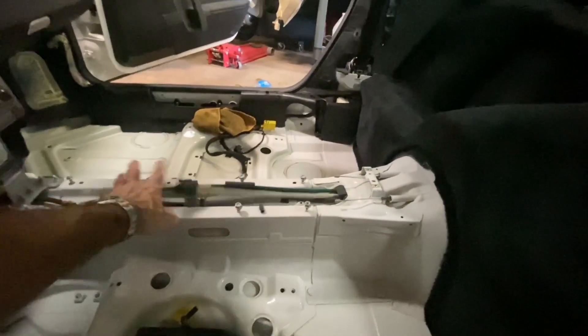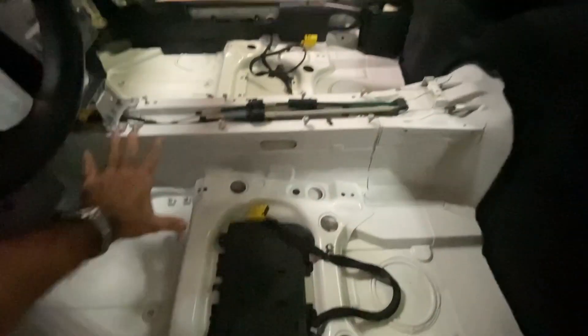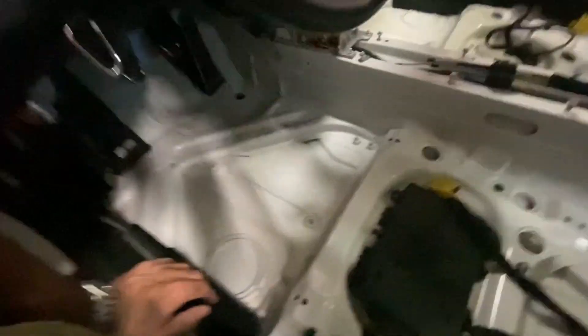First piece is in. So time to get moving. Stage two is this piece. Next we'll go the side panels and work the way forward, and then have to start getting all this stuff hooked back up. A little snag — I gotta put the carpet in before I can put the panels on, because the carpet snaps in place here and here. With the panels in place, it's gonna be practically impossible to get the ones in the back that go underneath the panel. So the main carpet has to go in first.